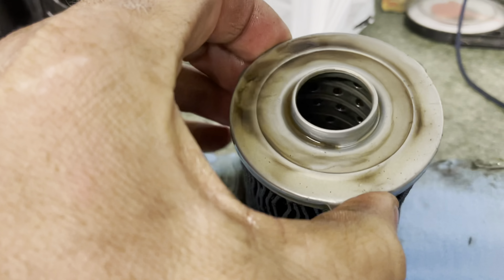Oil pressure is good, fuel pressure is good. Now on to the trans cooler — I'm going to set it in the trunk area. I made a little diffuser; I gotta get different bolts but this is the gist of it. Just took a piece of aluminum, cranked it down, and whenever this sits flat it's gonna divert air and go through that — so it should do the trick. We're gonna find out.